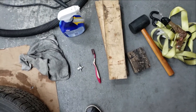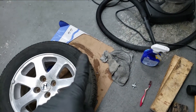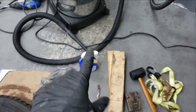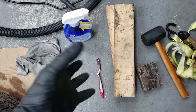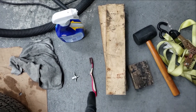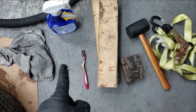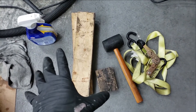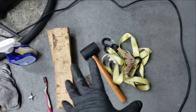You're going to need a towel to wipe up any of the excess soap. I put the wheel on a piece of cardboard because when you break the bead you're probably going to face it on the face of the rim and you don't want to scuff that up. You'll need some soapy water — I mixed dish soap and water into a spray bottle — which I'll use to check for the leak. You'll also need a toothbrush to clean the bead, and some two-by-fours; you'll need a couple pieces and a small piece, and you'll have to measure and cut your own size.